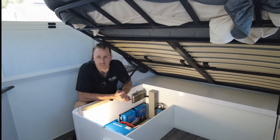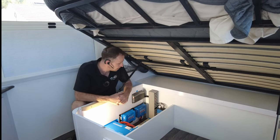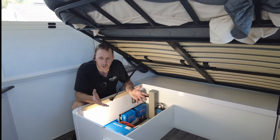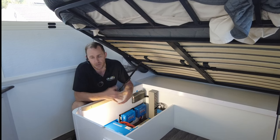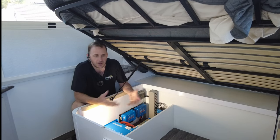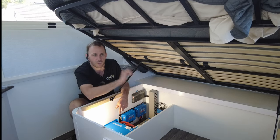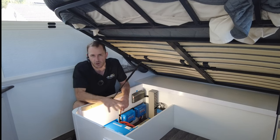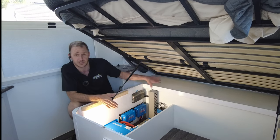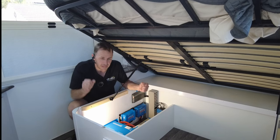Thank you to Enerdrive for releasing a really awesome piece of documentation — probably the most detailed one we've found. I'll put a link in the description. It's a very detailed document on alternative battery locations for you guys with caravans, covering where and where you cannot fit lithium batteries in a van. We don't like the chassis mount for obvious reasons — they're down low, they're outside, water ingress, dust ingress. The Australian environment is horrible. If you can put them in an enclosure somewhere, it's a much better scenario, just like these are in a tunnel boot.